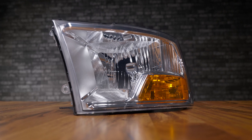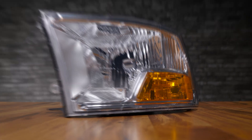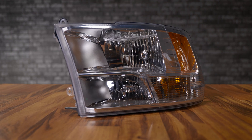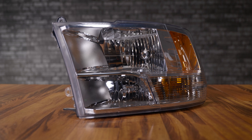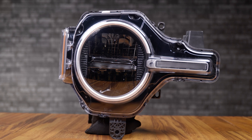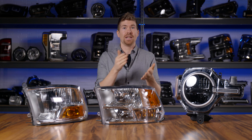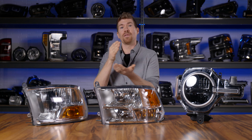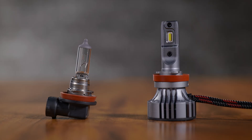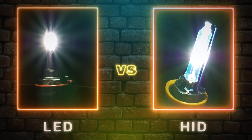So if your vehicle has one reflector area and the bulb does both low and high beam, you have a dual beam reflector housing. If you have two separate reflector areas — one for low beam and one for high beam — you have a single beam reflector housing. And if you have something where you can't replace any bulbs on the backside at all, this is an LED reflector headlight. Make sure you keep into account your bulb type: if it's an H11, 9005, or 9006, just get an H11, 9005, or 9006 LED or HID replacement bulb. If you want to know what's better — HID or LED — we've also made videos on that.